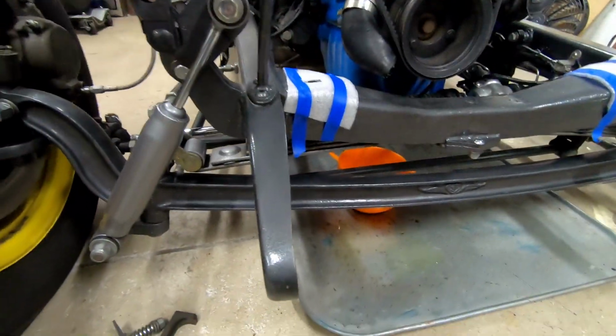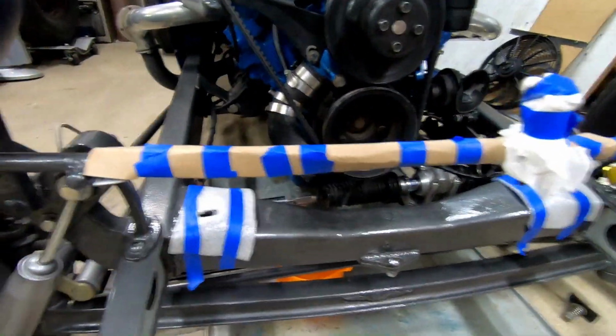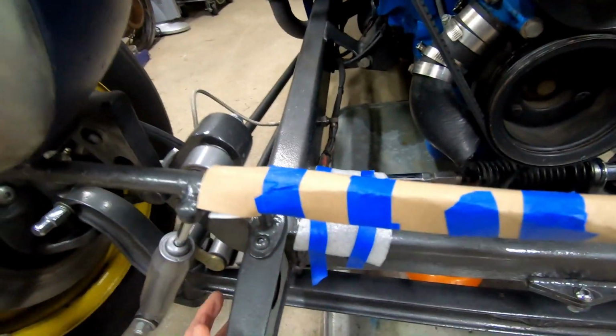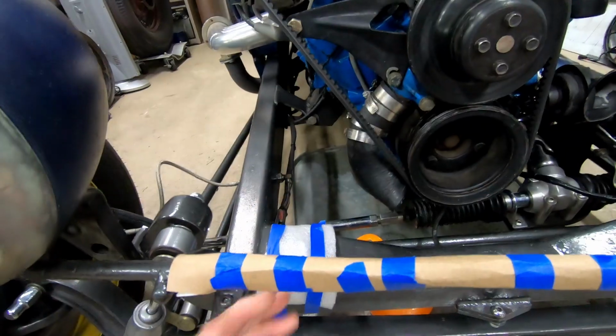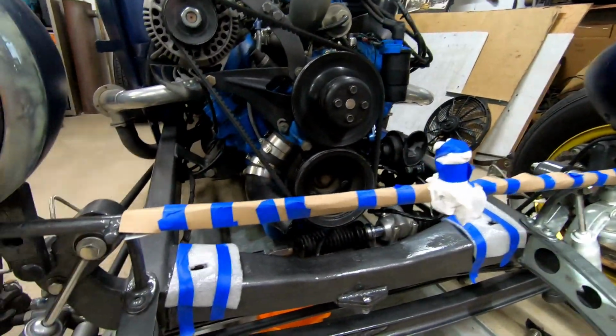And due to the suspension on the old Ford hot rods, every time you hit a bump in the road, that shock is felt by the frame and transmitted right into the radiator. And I believe that's what's cracking these radiators.